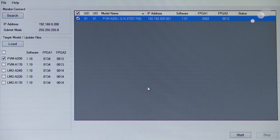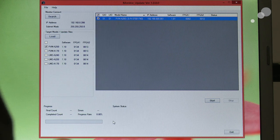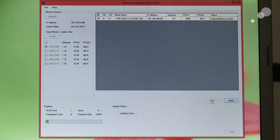It may open a window asking you to point it to the folder with the software update. We're going to hit the start button and get the update underway. You'll have a progress bar showing where you are — it's going to take about 30 minutes for the update to take place, give or take. The usual rules for firmware updates apply: make sure you use AC power on your laptop and wall power for the monitor. So here we go — hitting start.